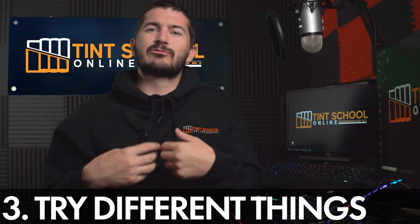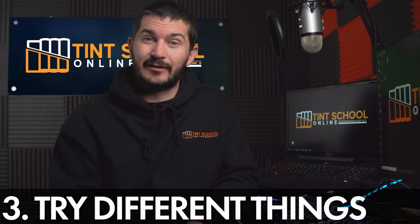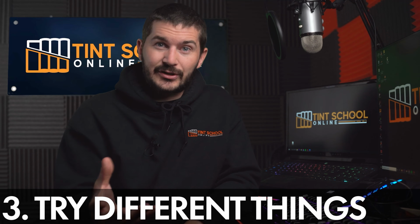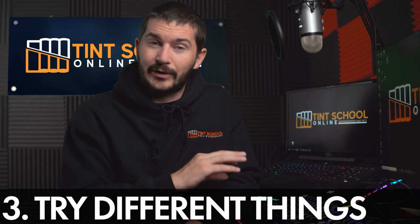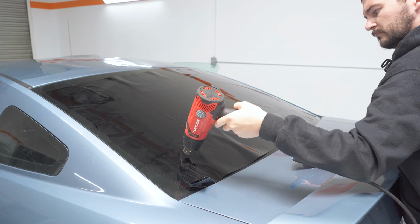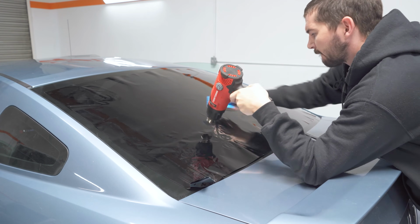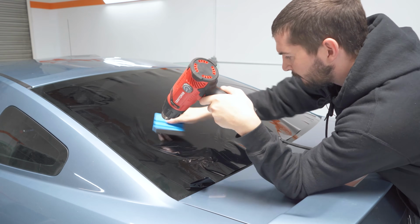So in order to be able to really understand what is happening with the film, you need to keep pushing yourself. If you make a mistake, for instance, don't throw that piece of film away or carry on shrinking it as normal. You need to use it as practice. Find out what happens when you do overheat the film. Find out what happens when you try and shrink and push the whole window out in 20 seconds. Try different things to help your understanding of the window film shrinking process.